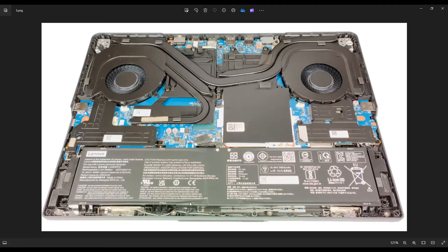Here's the battery across the bottom of the screen. There are five screws holding this battery down — two here, two down near the bottom, and one is actually hidden underneath this metal guard for one of your solid state drives. So you have to take off this shield for your solid state drive first. There are three screws in it: one on the right, one down bottom left, and one up near the fan. Once you get that shield off, you'll be able to access that hidden screw.